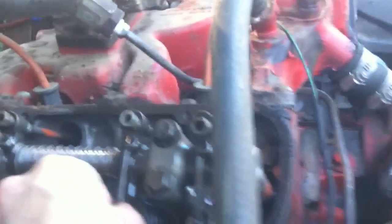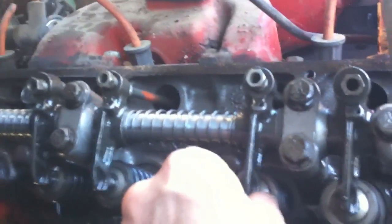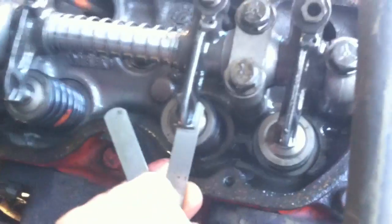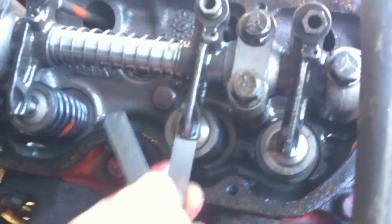You can see that the exhaust valve is being pressed down to open, letting the charge out — so that tells me the intake valve is at rest with no tension on it. What we're going to do is take our 12 thousandths feeler gauge and slide that in there. I already adjusted these.